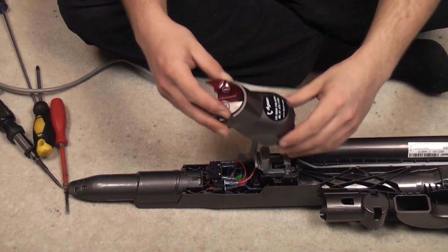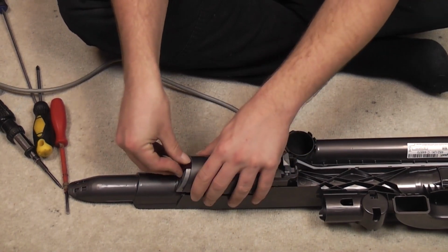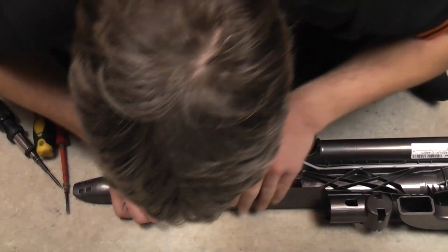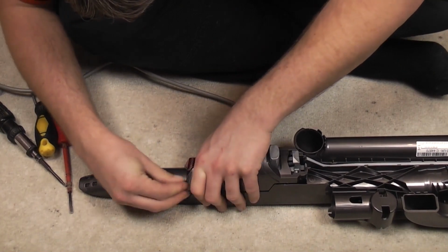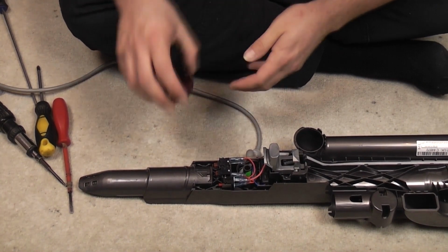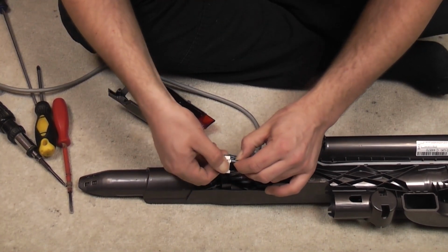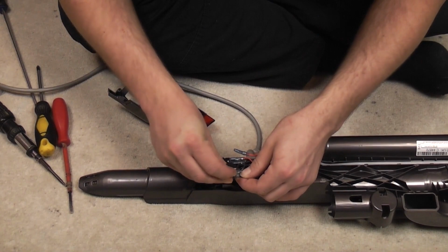With that, you need to, and again this is a little bit tricky but you'll get there, lift up the switches just a tad, just enough to clear the switches inside. He says, having got something terribly caught. What's terribly caught? Oh, right, that hasn't just gone straight on, so something is wrong somewhere. And I do have a feeling that we have actually got the brush roll reset switch the wrong way round. So we'll just try it the other way round.